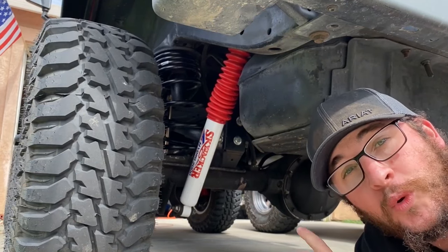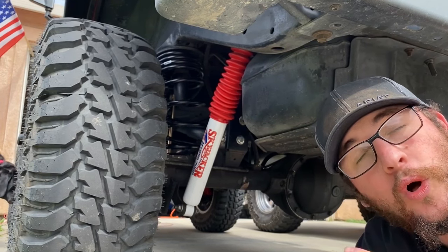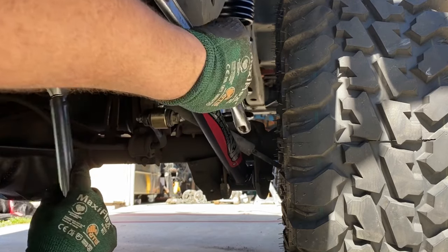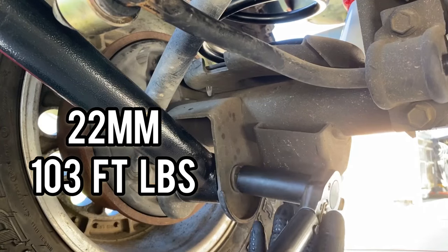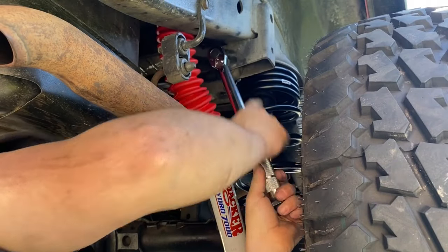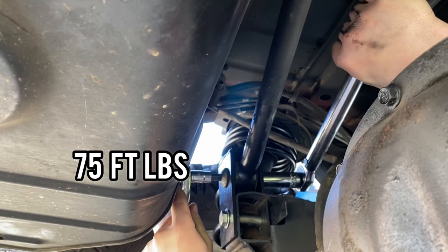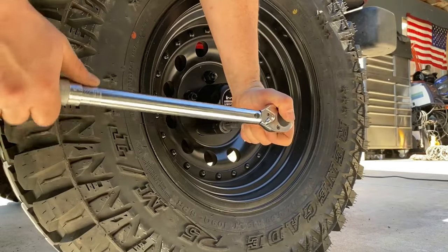At this point of the install, go ahead and install your shocks — check out the video link below on how to remove and install all four shocks on your Jeep. Once the Jeep is on the ground, revisit the lower control arm bolts and torque both the frame mount and axle side to 103 foot pounds. Then torque the frame end of the track bar to 74 foot pounds, the mount to the axle at 75 foot pounds, and the track bar to the new mount at 75 foot pounds. Finally, torque all lug nuts to 95 foot pounds.